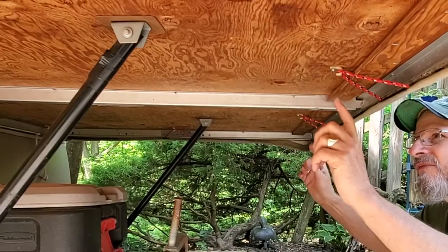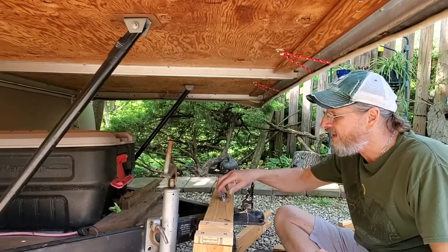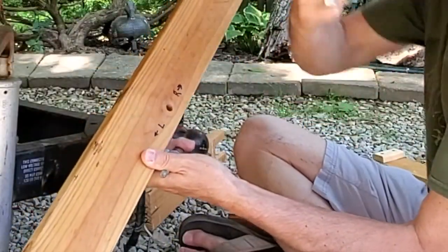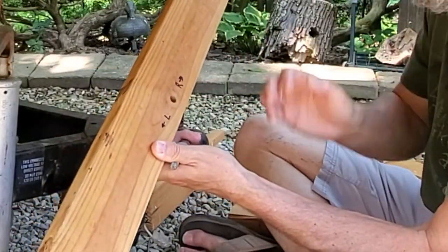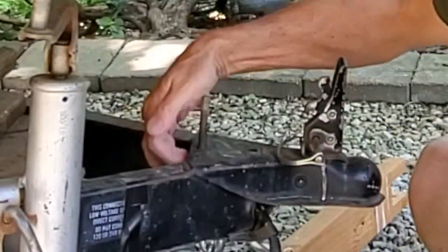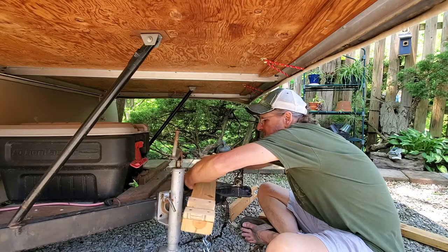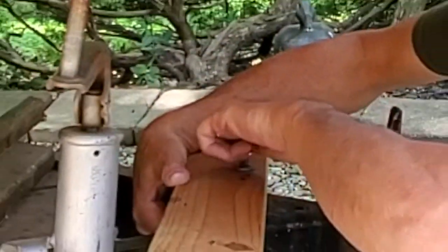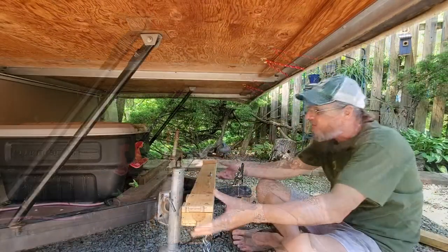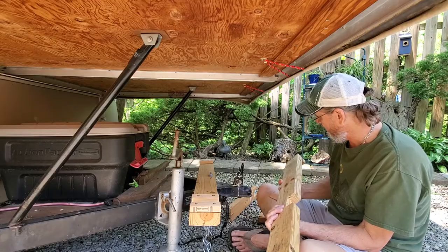It's just too much weight for these support legs. So what I did was come up with a system on the back — I took a two-by-four, left and right. I always mark everything like that to make it clear to me. There's a hole right here on my hitch; this bolt goes through here like this, and this piece comes over and goes on that bolt just like that. If you want to do it right, go ahead and tighten it all down with a wrench, especially if you're going to camp for a week or so.